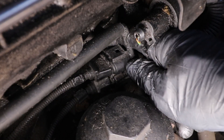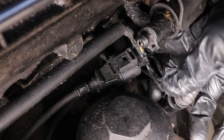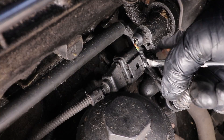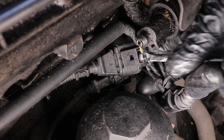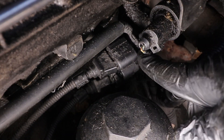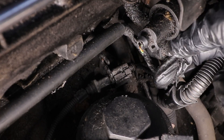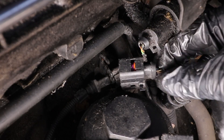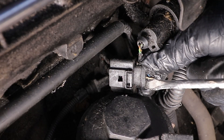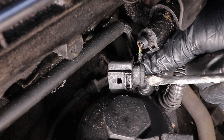To take the connection off, we just need to slide it forward out of its mounting bracket. Then, with a thumbnail or a screwdriver, just bend the little tab and it should slide off. On this engine, pin 3 is the brown earth wire, with two other wires — the central one being the signal wire and the blue one the feed.